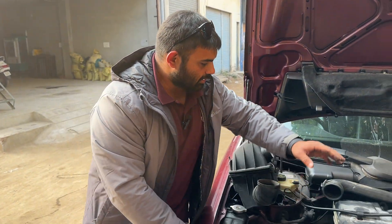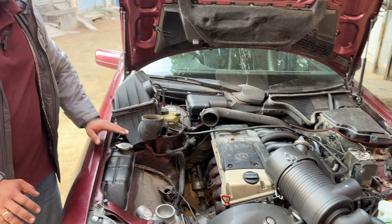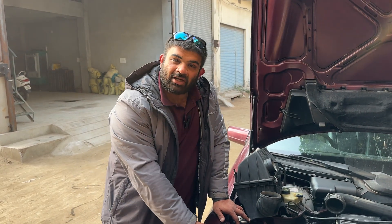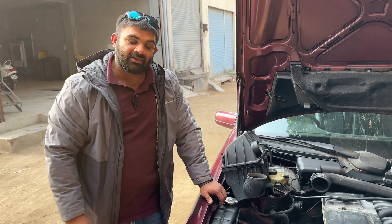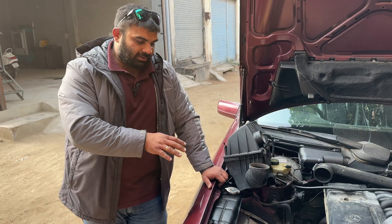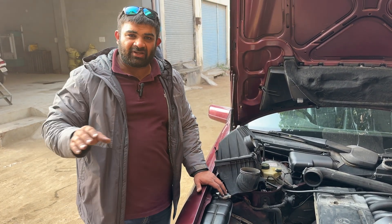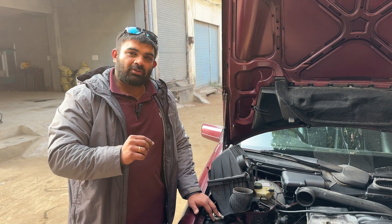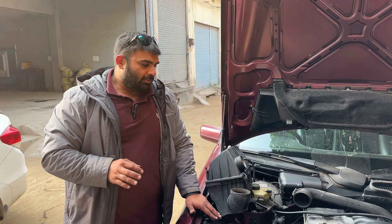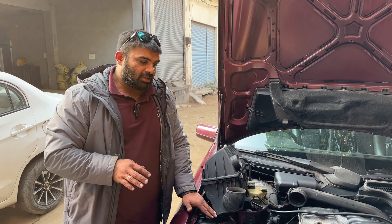This being our option, the turbo is going to pump fresh air into the inlet and it goes into the plenum. We're probably going to go ahead with the BorgWarner S100, with a boost gauge inside, because I've really liked the quality and it has a lot of good reviews. Even though I came prepared for an HE250, I am very much convinced with this. This engine runs perfectly with a 1.4 bar setting, so if we can touch anything around 1.2 to 1.3 bar, we don't need to play around a lot. In the first stage, we are not going to install an intercooler — this is going to be a direct turbo install.